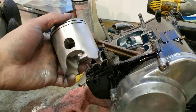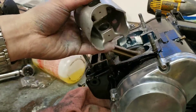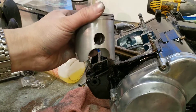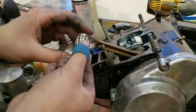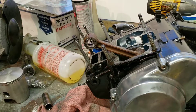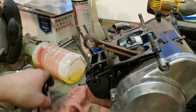As you can see guys, the old piston is off. This piston is not the nicest one either — you could tell they didn't drill the holes like the new one has for the bridge, so it wasn't getting proper lubrication. Overall though, this piston is in good shape. I believe they grenaded this thing and then slapped in a new piston that was stock size. The bearings look okay — they're not bad — so I'm going to be reusing those needle bearings. But I believe that was the fault originally when this motor blew up the first time and they just kind of slapped it together to sell it, which is kind of a shame. But yeah, she's ready to go.